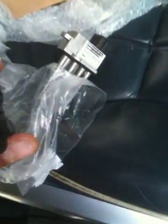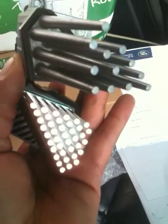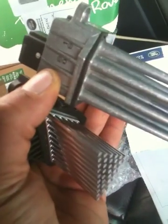They've sold me a Valeo again — I think it's French, so that's who makes these. As you can see, there aren't any wires sticking out behind the new final stage resistor, as opposed to the old one on the right hand side. The factory ones, as far as I know, have the black connector housing around them. As you can see from this one, it's all aluminium. The shinier one is obviously the brand new one I've just unpacked. The connectors are the same size, but the resistor part looks smaller, thinner, lighter, and shinier.